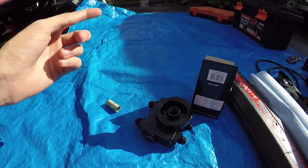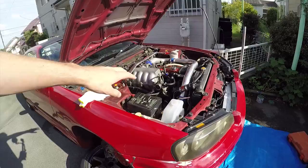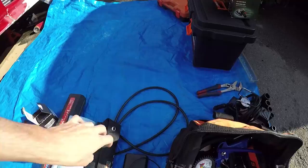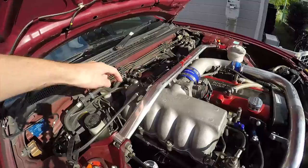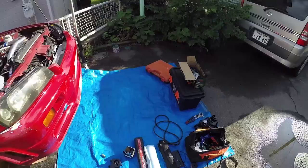Instead of running three lines - two off the block into here and then one that goes to the cooler and back to the block - you need to run four lines, because this needs to be able to send it back to the block if the oil isn't hot enough. We're also putting in this shorter black silicon hose for my MAP sensor off the ECU - instead of going all the way around under the dash, we're going straight down through where the wideband wiring goes into the ECU. It's heat resistant and I'll also be putting heat shield over it.